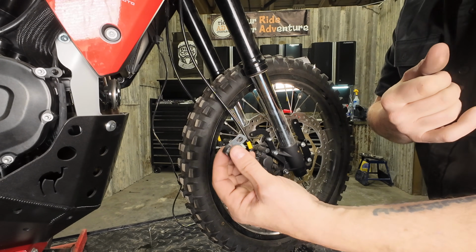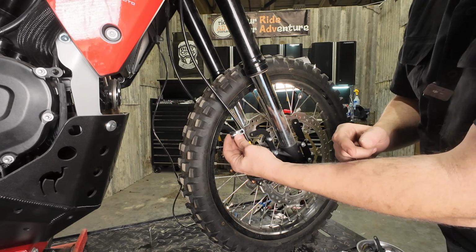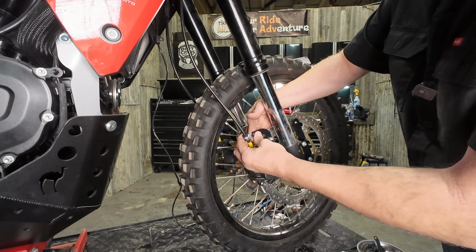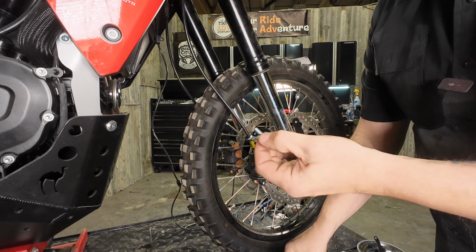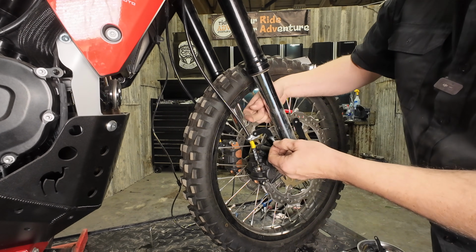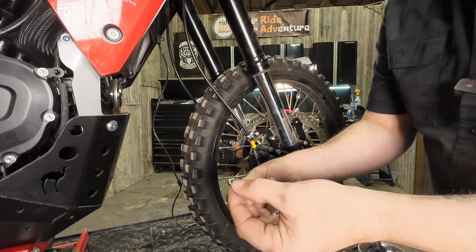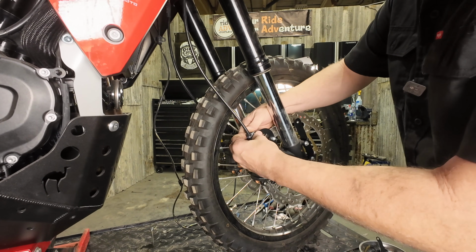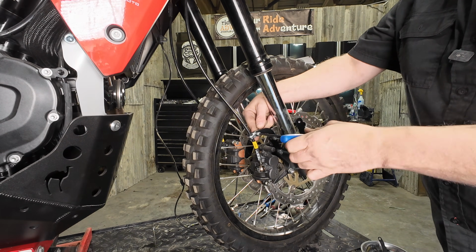So we're going to take one of our P-clamps and we're going to put it around the brake line in this orientation, the flat side facing out and kind of the bubble point on the P facing in. And then take a 6x16 bolt through our cable guide bracket here, and then a flat washer and an M6 nylock. So it's just going to connect like that.